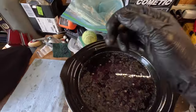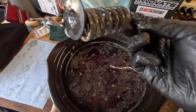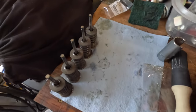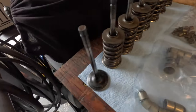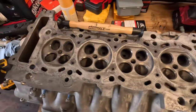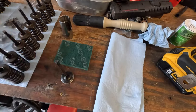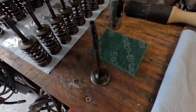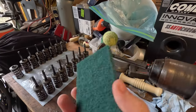He's been in here for a couple of hours now. A lot of the oil came to the top. The valves look better, still needs to be rinsed off - and it's freaking hot. Another new day - we're going to clean these valves up really good and clean all the carbon off. I've got a little piece of plastic straw that I cut a slit in, I'm just going to slip it over the top of the valve and chuck it up in this drill, then hold the Scotch-Brite on here to clean it up.